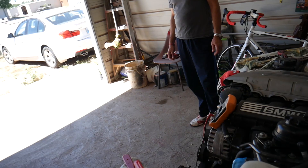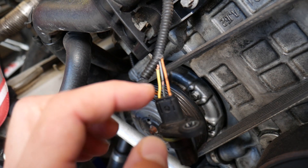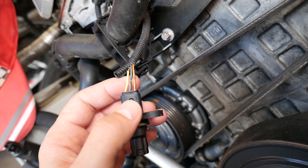With that being said, we need to go outside and find your ground wire, the ignition switch wire, and the wire known as the signal wire. To do that, you can simply unplug the sensor — let's remove it a little bit to show you. You need your voltmeter set at the 20-volt reading.